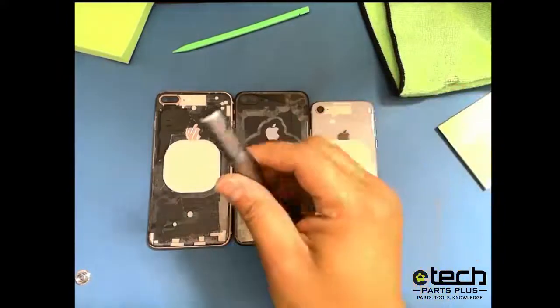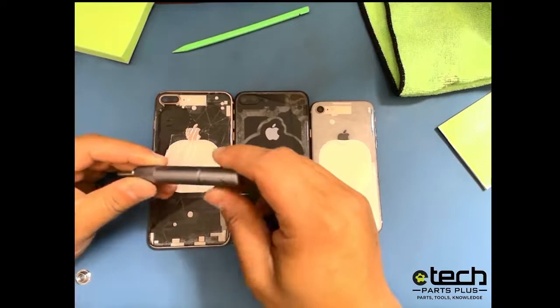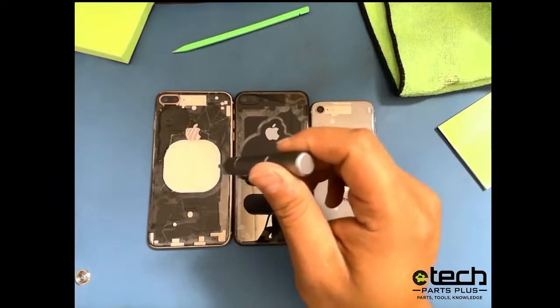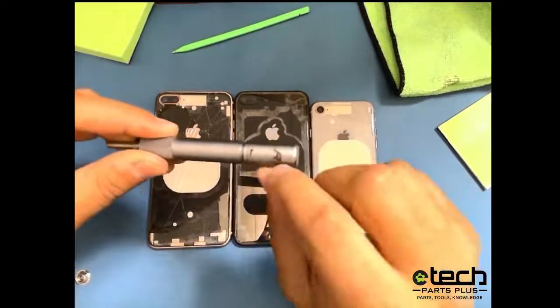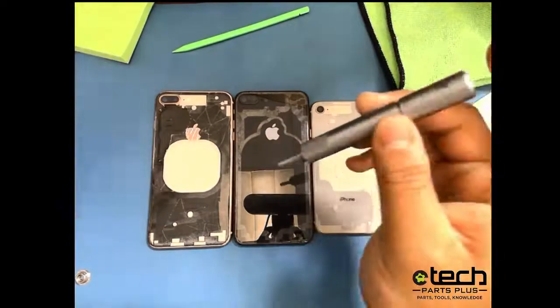The second thing is, as far as tension goes, I would usually pull it out or loosen it as much as you can so it has minimal tension, so the impact is very light. And then if it's not cracking it, adjust the tension from there. We kind of already have ours set to where we like the power at least. So as far as using it, it's pretty straightforward.